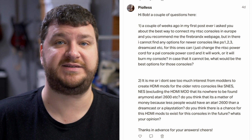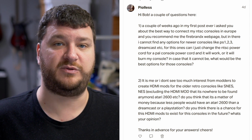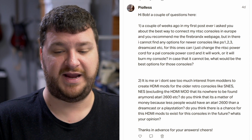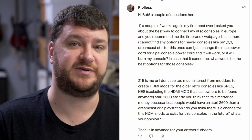And for things like the Dreamcast, there are internal power supply mods you can do that allow you to use an external universal power supply like the Triads, but on the inside you would have a more generic DC to DC converter. Each console has their own revisions out there, and each console also has kind of low-end and high-end solutions, and some of them are a consistency issue because you have to rely on a Pico PSU, so you need to get one of those from a reputable seller, and it gets kind of complicated. So what I would say is tackle each one of those consoles one at a time and be prepared to open it up and double check. Check the power supply rev you have, see what replacement options are out there. It should all be plug and play. I don't think you would need to solder anything.